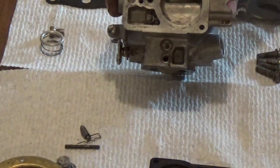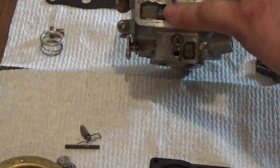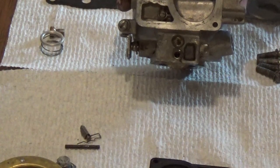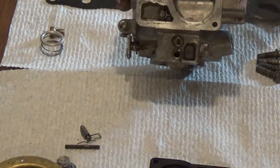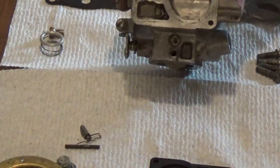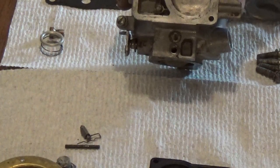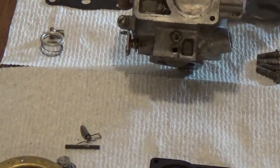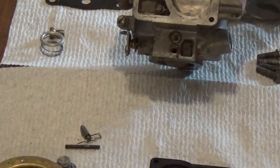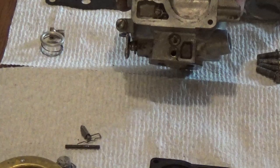When I'm assembling this carburetor later in the next video, you're going to see that I dab just a little bit of grease on these springs — I do that to help retain the springs while I'm assembling the pump body. So keep that in mind: you definitely need to put something on those springs to keep them from falling out. I choose grease, but there are many different methods. You can use Vaseline — I've heard of people using Vaseline. You can even use really thick motor oil, it works very well, but I personally just use lithium grease — just a little tiny dab of lithium grease — it works very well for me.